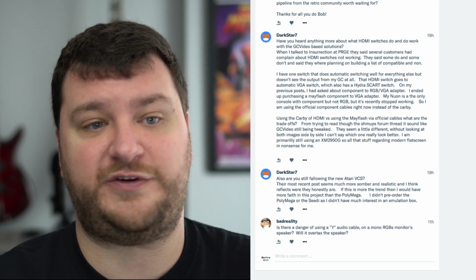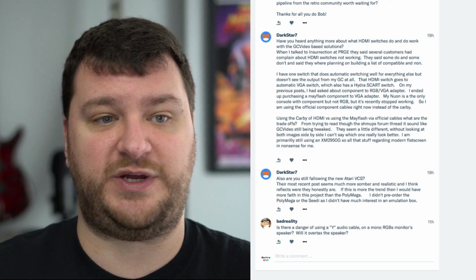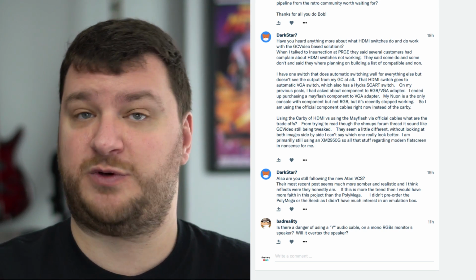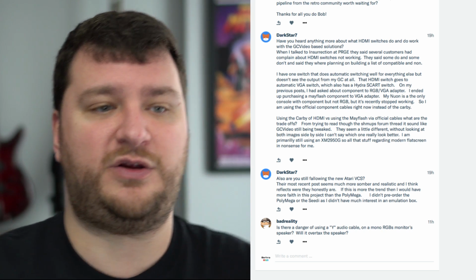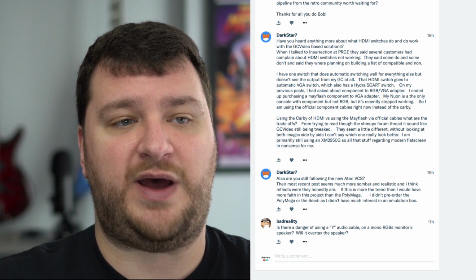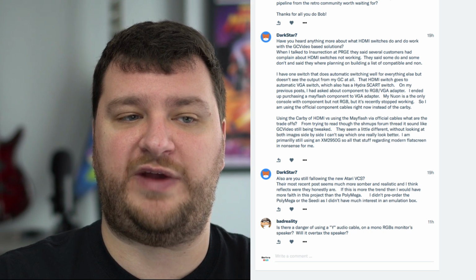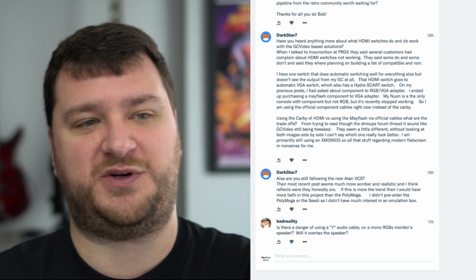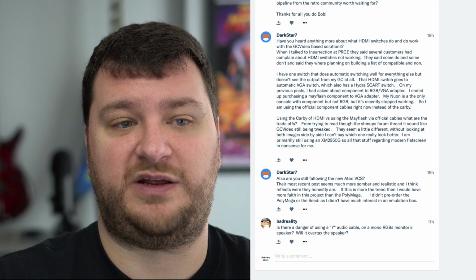If you already owned the official component cables, I would say use that into a key digital converter into your VGA switch. You mentioned a Mayflash converter, but I've had mixed experience with those in the past. If it's working good for you, cool, but I think they do a lot of rebranding. But at this point, you're talking about a setup that's going to really apply specifically to how it ends up in your chain. So I would just keep trying until you find a solution that you're happiest with. I could be a little bit more of a help if you're going direct into the monitor, but HDMI to an HDMI switch, to a VGA switch, to a converter, there's a lot of stuff in that chain that could affect the signal. So I just would use whatever you feel you've been happy enough with.